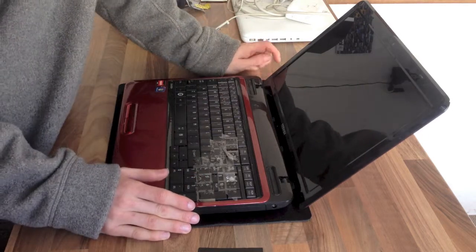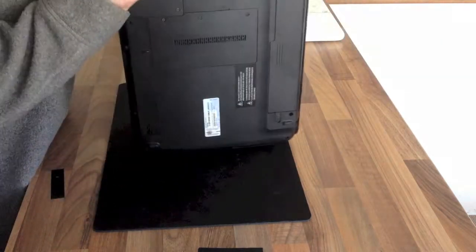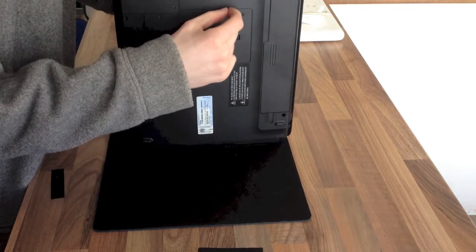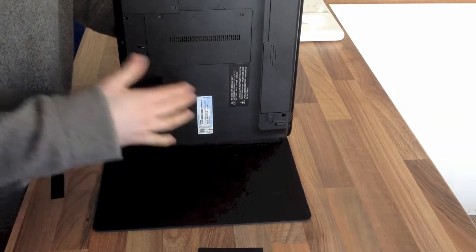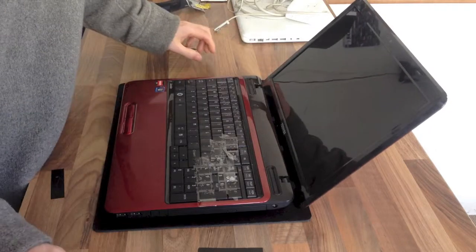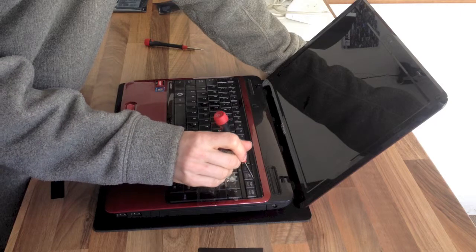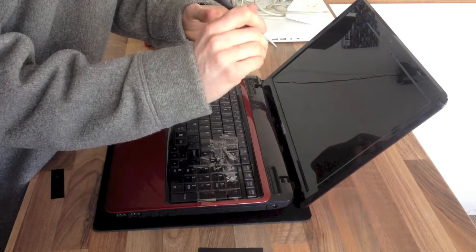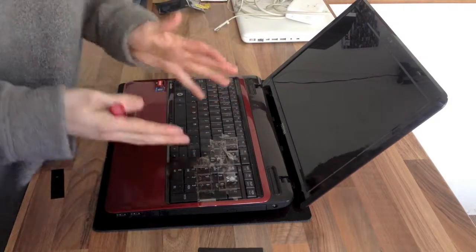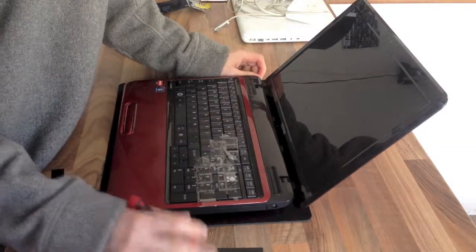Occasionally the keyboard is also screwed in from underneath, which again may be screws along the midsection. They usually have some kind of keyboard icon around near said screws. And lastly, the other variation is occasionally it's clipped in with clips that are visible just along the very top between the plastic and the keys, and you have to push the clips out of the way with a screwdriver and lever out. Basically, just have a look at what you've got, look at it carefully and see what's there, and you'll probably be able to figure it out.